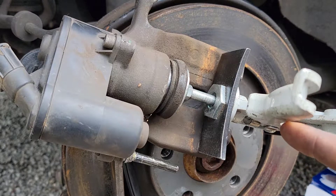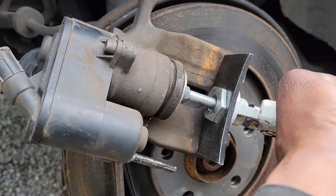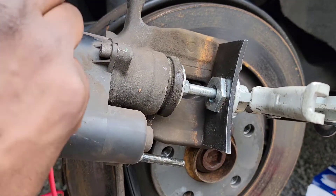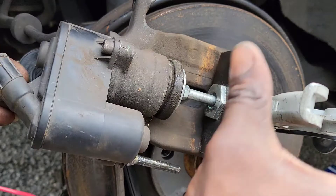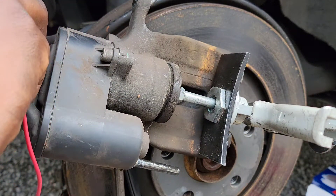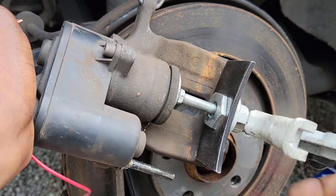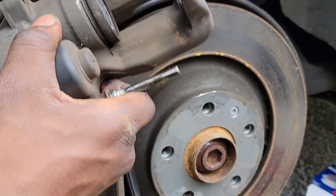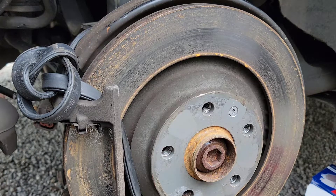As you can see, I put the caliper tool right there so you can press it in. After you get the motor going to drive the piston in, you press it in just like this — and that's how easy it is to get it in.